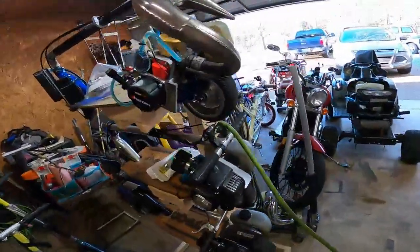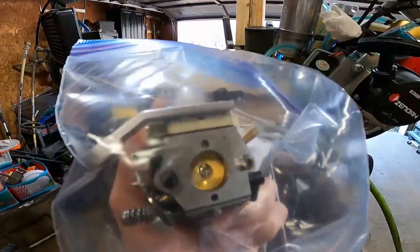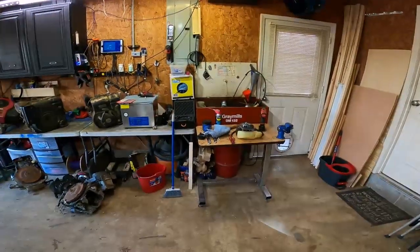The water cooled sport is down. I used this carburetor when I ran that engine over there on diesel fuel, and I really regret doing that. What happened is there's two check valves in the diaphragm area, and they both run the metering jets. So you get your high and low, but there's these little check valves in there, so that way you don't just flood out.